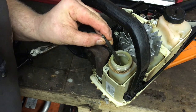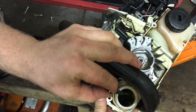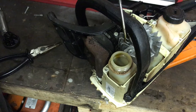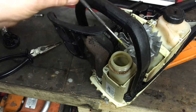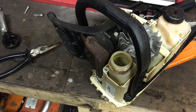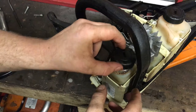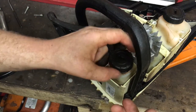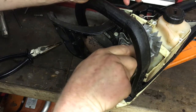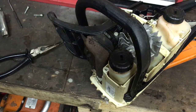I can just about see the filter - it looks quite good. Usually you can tell depending on what oil you've got in. This looks quite good. Vegetable-based oils can go quite lumpy and laggy inside the tank and seem to block the pipes up. I find the Stihl chain oil itself goes quite lumpy, and when you get to the end of the drum you get a lot of debris and bits of crud in there. I've been using a petroleum-based chain oil and that seems to be a lot better.